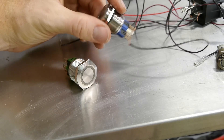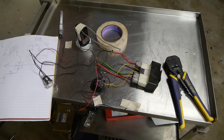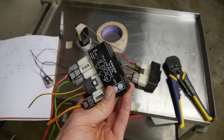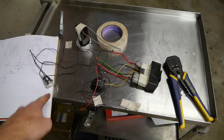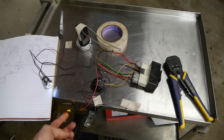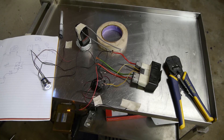That's how you wire up one of these six-prong switches to work. Now I'm going to show you how to wire it with a Volvo relay, because I'm going to be using this switch to power a fan. Off-road guys will be really familiar with this relay — it's a super high CFM fan out of a late '90s Volvo, and they move a ton of air. The problem is the Volvo relay is activated by ground. So if you want the switch to light up but still activate the Volvo relay, you need to use a regular 30-amp relay to reverse the polarity. Switch on, LEDs on, ring light on, and we're lighting up the little LED. You can hear both relays clicking when I switch it on and off.